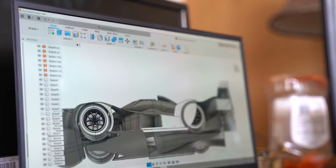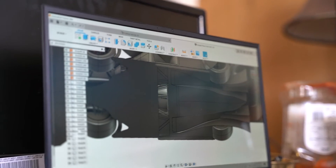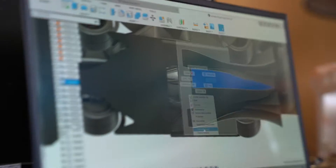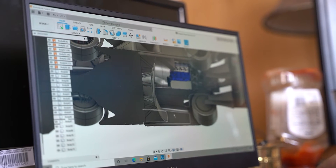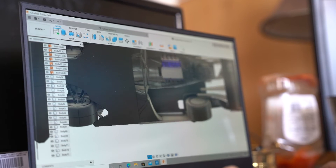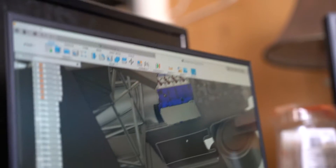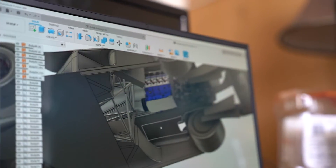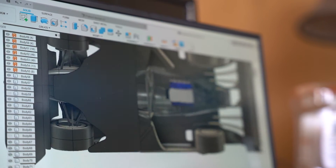I've got Brian working on the fuel cell, so I gotta get a measurement. I'm getting a measurement from the engine to the firewall so I know how deep to make the fuel cell — we need more volume than the previous car. We've also lengthened the wheelbase by about 10 inches.